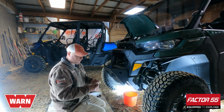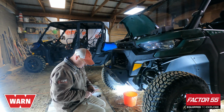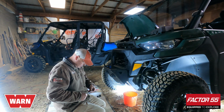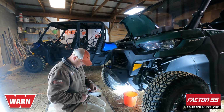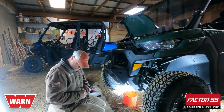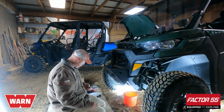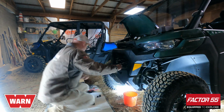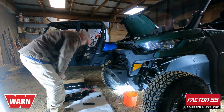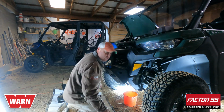Basically, I was just separating the bolts for the winch and the bolts for the fairlead. I want to make sure I have the right wrenches because some stuff nowadays is metric, some stuff nowadays is standard. Like there, it's not 11/16, so it is metric. Yeah, so I have the right Allen, just do not have the right box end. Make sure I have the right size. And it is a 17 millimeter.